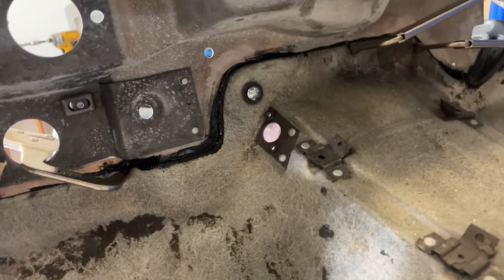Let's get some of these self-tapping screws in just to kind of secure this — probably just two or three until my rivets come in, to make sure this is held down in the proper position. All done — I put in four screws just to hold it down until I get my rivets in. I'll add a little bit more bonding cement underneath some of my clamps just to make sure I have a seal there, but I have plenty of glue on there — it was squeezing out pretty nice. I'll probably do the rockers maybe Thursday. I'm going to let this set up real nice before I remove my clamps and get my rockers in. Pretty exciting — going back together, guys!